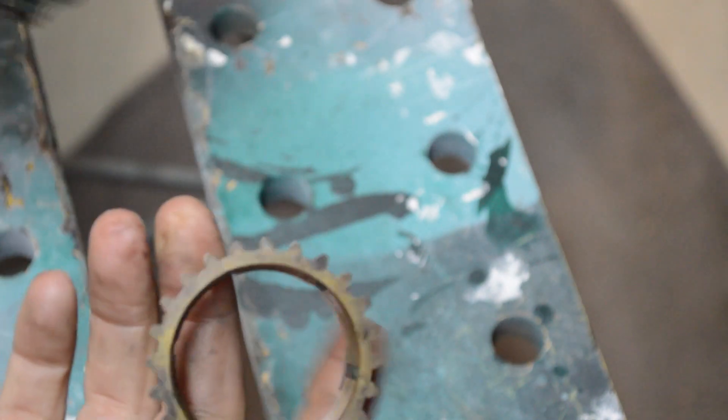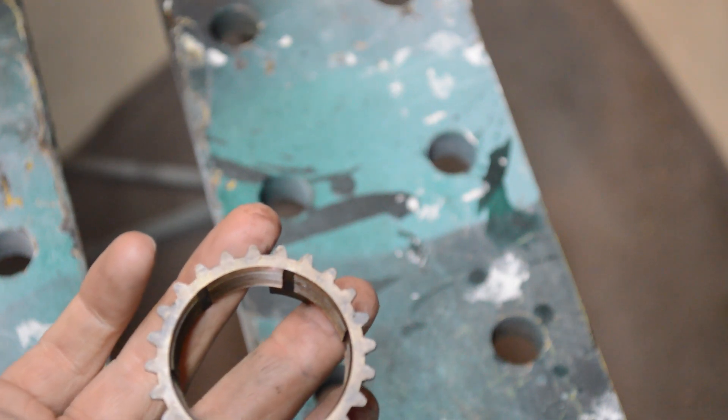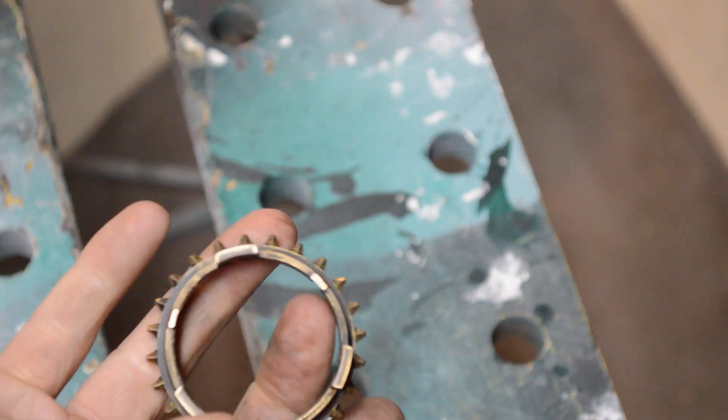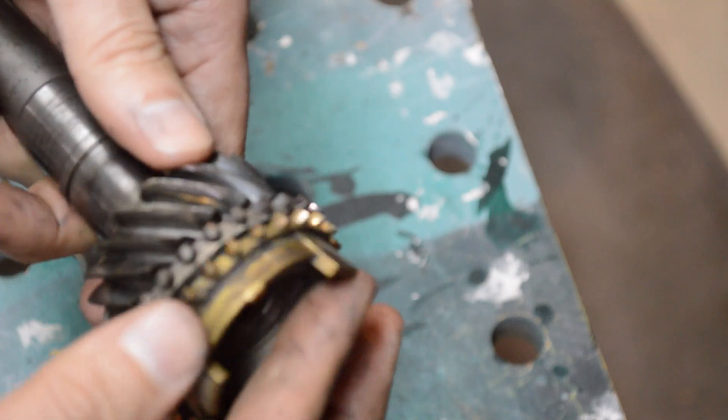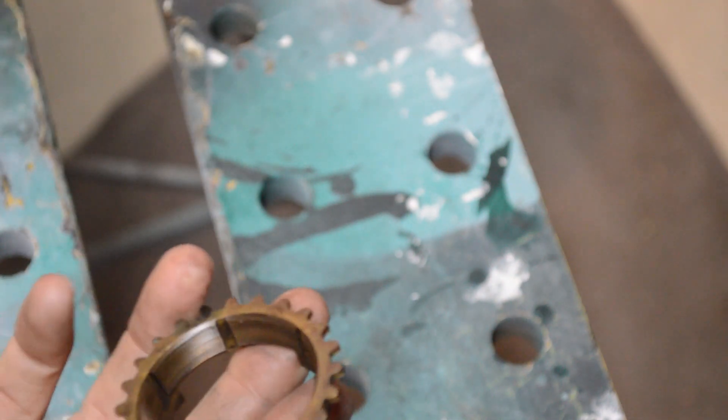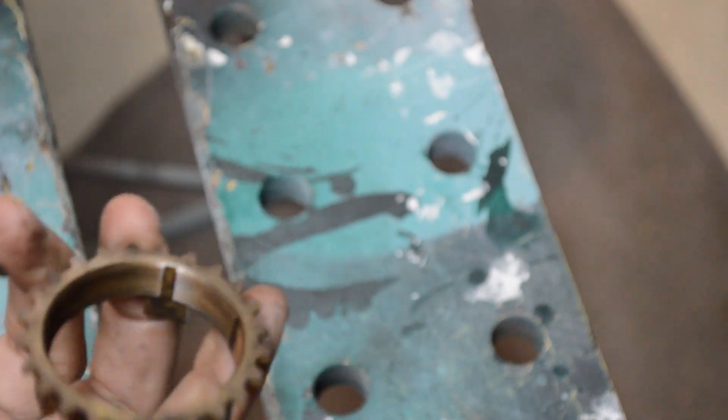You could find new synchros, but the quality isn't always the best — though I've heard it's gotten better. If you're going to buy a set, go for it, but check it on the actual gear and compare to synchros you know are decent. Usually I will try to put the best ones on second gear, and maybe the second best on third. Second is probably the most important, followed by third — that's the order they're going to wear out.